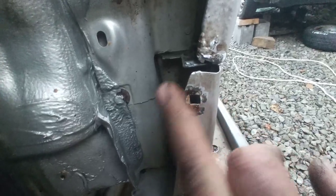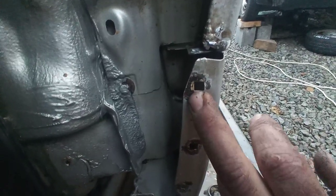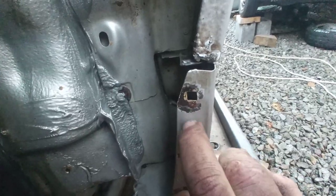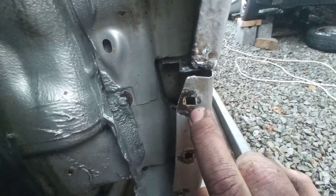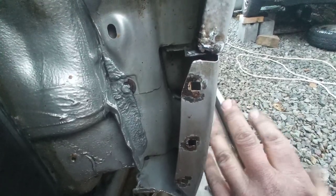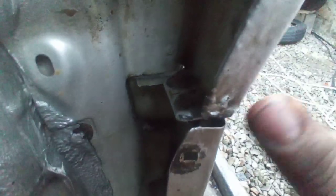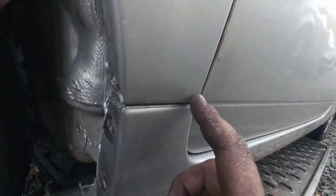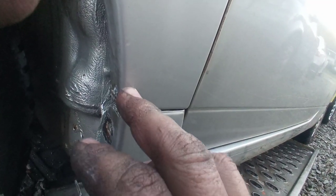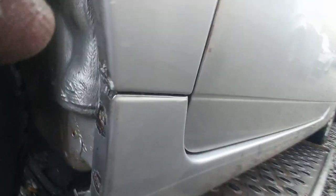You can mix it with the hollow section wax or anything else. It's good to mix it with something which does not go as hard as this paint, but which stays a little bit soft, but not too much. I recommend the hollow section wax and maybe a little bit of some basic paint. The aluminium you can clean and coat with the spray on the aluminium parts, in case there is oxidation already here. So you can take some putty and make it as clean as possible.